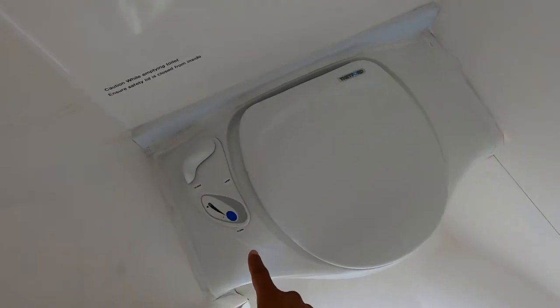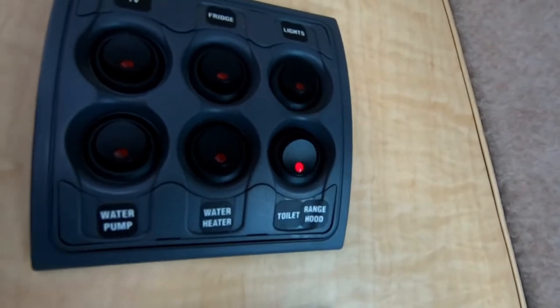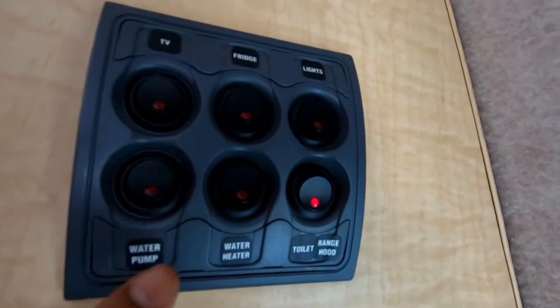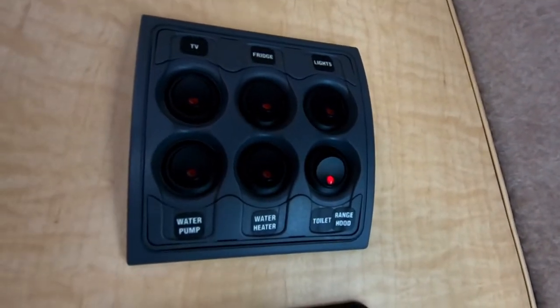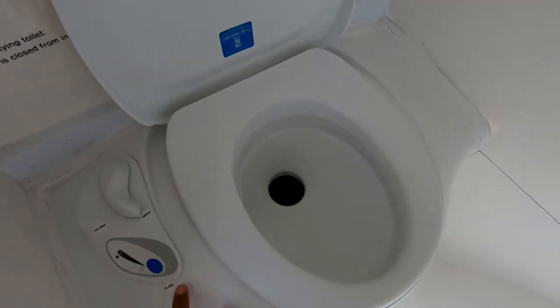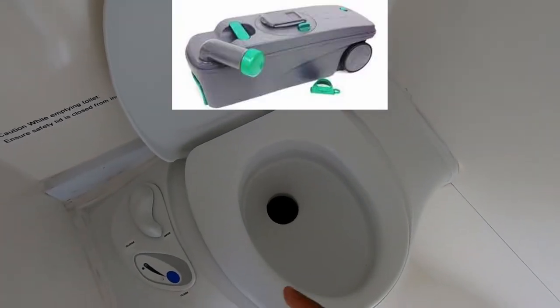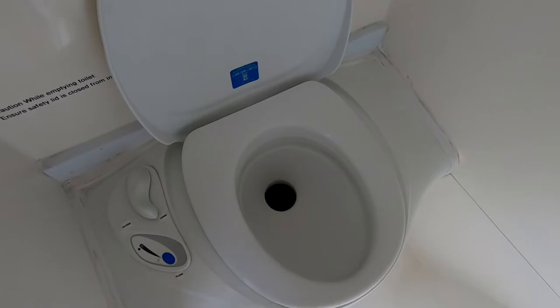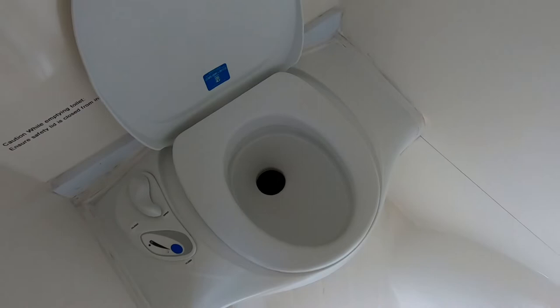In this video I'll show you what to do when your flush is not working. You can see pressing this and it's not working. First thing you need to make sure is that your main switch for the toilet is on — normally it's connected to your toilet or water pump switch, but this could vary on the type of motorhome or camper you have. Make sure that's on, then check the toilet. Also make sure your cassette is in, because some newer models will not activate the flush unless the cassette is in — there's a safety switch in there. But as you can see, no matter what I try, open or close, it's not working.